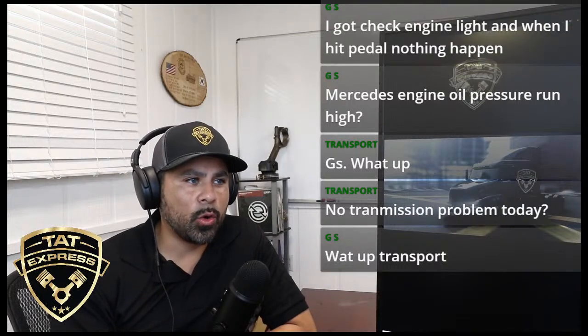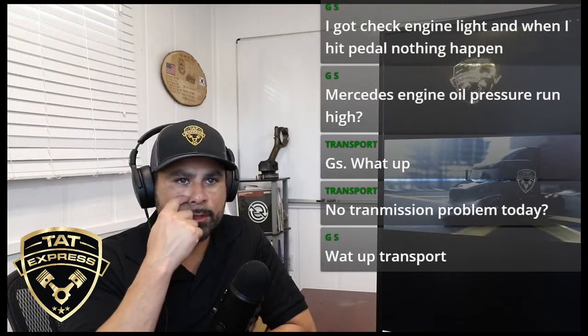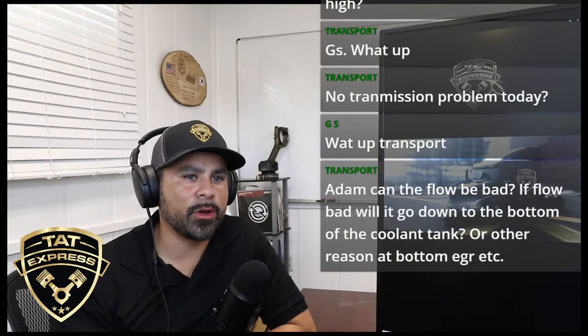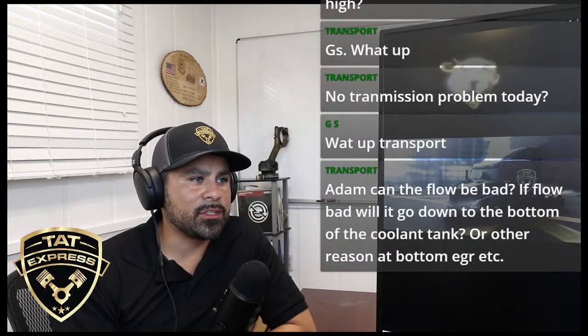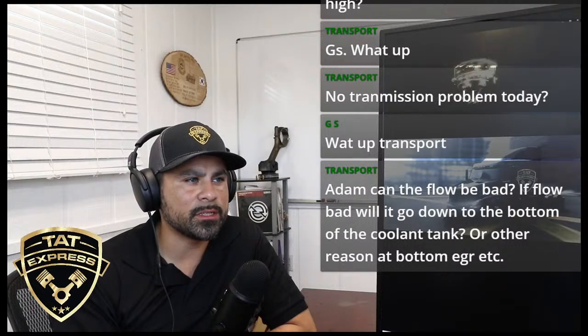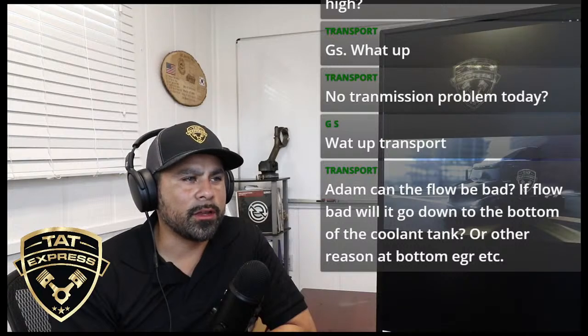So before going that far, I would do as much digging as possible before pulling the entire engine, because if you have something going on with your rockers up top, something to do with your valve train, it could be a head issue. If it does sound like something going on below, then you could have some issues. Now, did you just have some kind of big repair done, and now you're having knocking? What type of engine? Give me a little more information so I can lead you. But I wouldn't pull the engine just yet, unless that sucker's just done and you're ready to overhaul it.